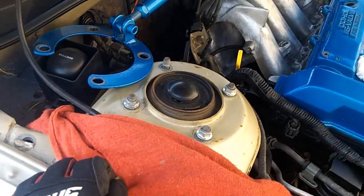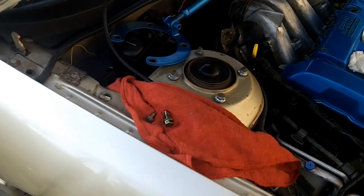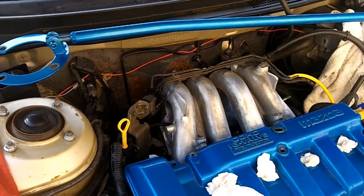That's something I can do in the future. For now, I'm sure that's going to last at least 50 miles or so before it works its way loose, as long as the engine vibration is minimal. Here's the bracket — it goes down there and should be bolted in with an M10 bolt, but it's just resting on top of everything. You can kind of see that hole right there — that's where it's supposed to be mounted, but someone along the way put it on top, just resting. I think that'll take the weight, so it's not really that big of a deal, but that's not the correct position. I should be able to get a wrench on there and tighten it down.